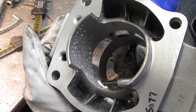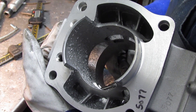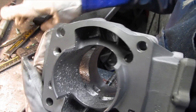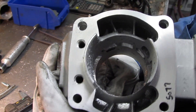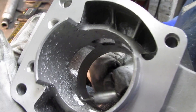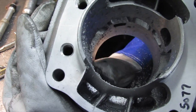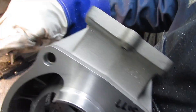This new design allows us to run more horsepower with less compression, which makes the motor more reliable. The old cylinders used to run 230 pounds of compression; these make more power at 180, so that's much easier on the engine, easier to kick start, same amount of low end or better, and way better peak horsepower. It's not uncommon to see one of these play motors making 62 horsepower or better — that's pretty good for a little 350.